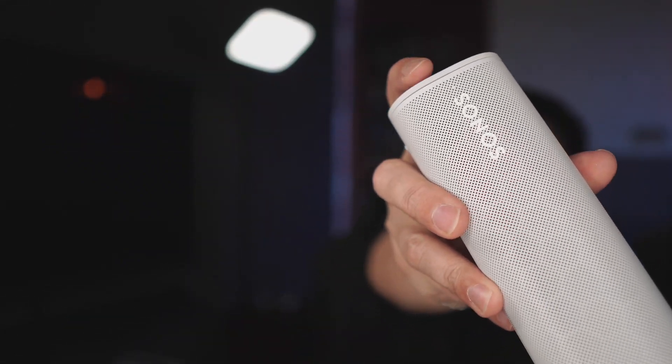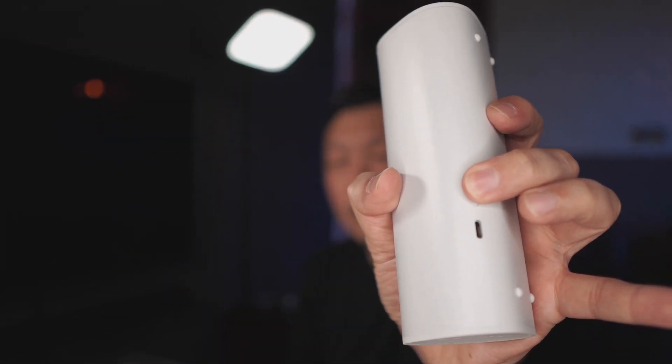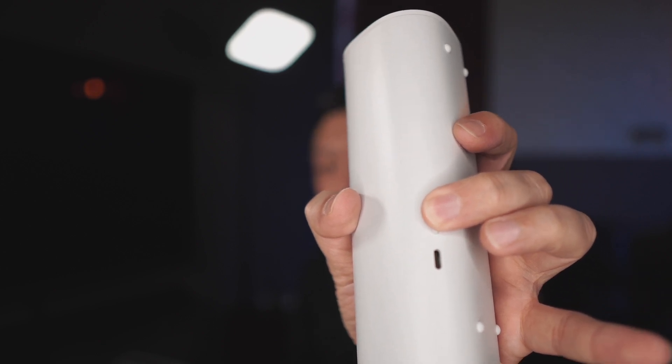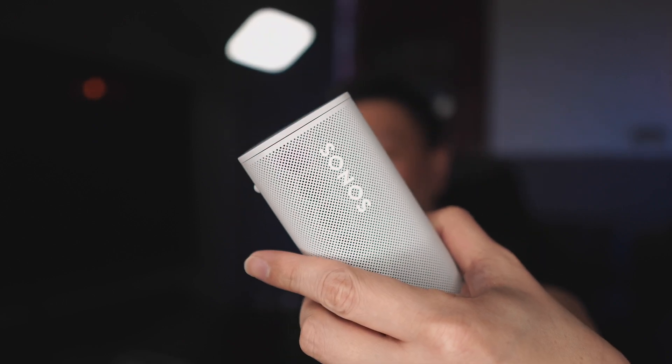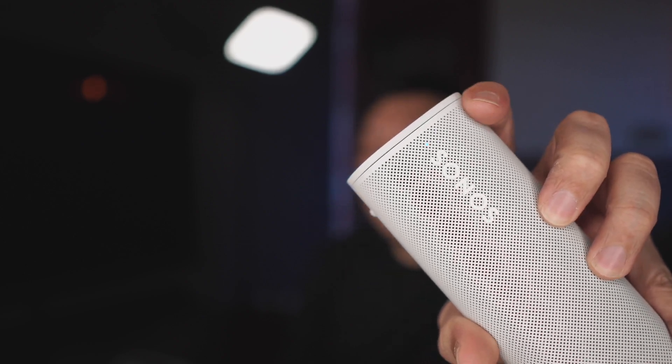I'll give you a demonstration of the Bluetooth gateway. If you look at the Sonos speaker, you'll see a Sonos logo with a white LED light on top, meaning it is connected as a Wi-Fi speaker. To connect it as a Bluetooth speaker, go to the rear of the speaker, press and hold the button until you hear the second chime and let go. You'll see the front blinking blue, meaning it's trying to get a Bluetooth connection. I've already paired this, so the LED has turned blue.